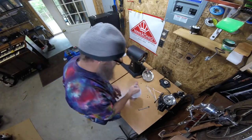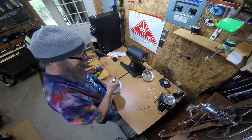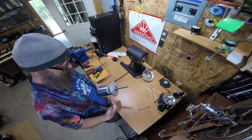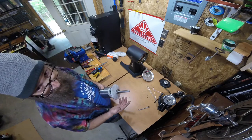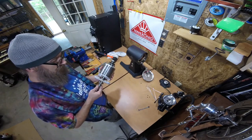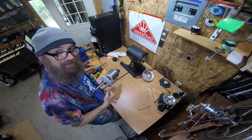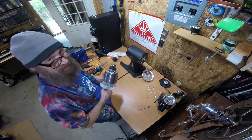Now let's look at the rotor. The front and rear bearings rest in the seats I've shown you. Then there's the impeller — it is actually capable of moving on the shaft if you're not careful, and when you put it back together it can hit stuff, which is not good. Make sure it doesn't move. If when you put everything back together it's hitting something, you need to push it on the shaft up to where the polished part of the shaft stops — it's rather distinct, so if you pay attention that shouldn't be a problem.